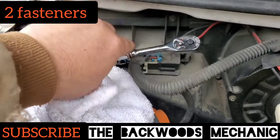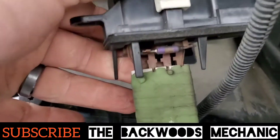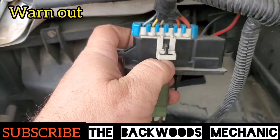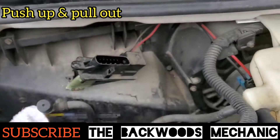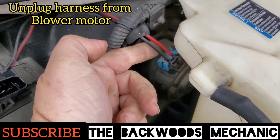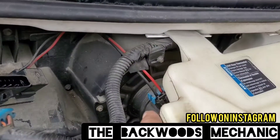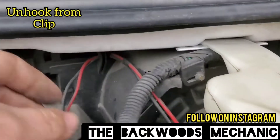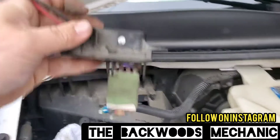All you've got is these two little fasteners right here and you pull the whole piece out. Right there you go — match up the new and old parts to verify that they are the same thing. As you can tell, this one is pretty rusty and pretty worn out, so it's more than likely what the problem is going to be. Now all you've got to do is unplug it from the wiring harness by pushing up on the clip and then pulling down. After you get that unplugged, set it off to the side. Follow these two wires and it should be hooked up right here — you do the same thing, pop the clip and pull that harness out. As you can see, it plugs directly into your blower motor, so if it's not working, your blower motor is not going to work. It basically sends a signal to the blower motor to go into the speeds that you want. It'll be wrapped around a little clip right here — all you've got to do is raise it up and over top of that clip, and then voila, you're ready to pull it out.